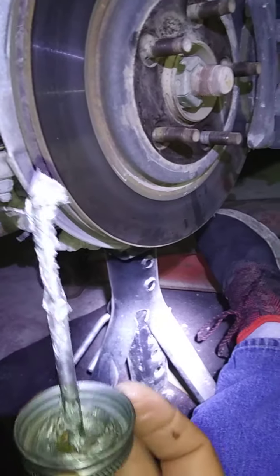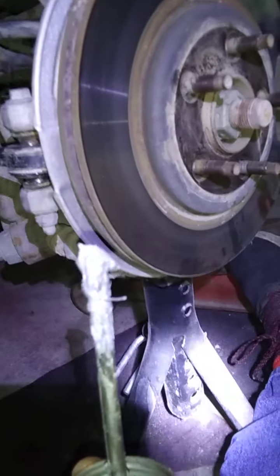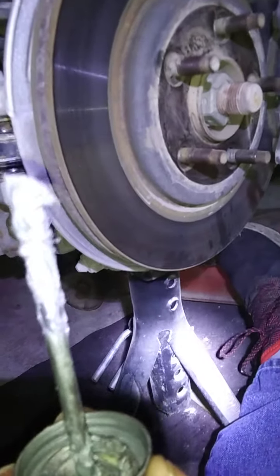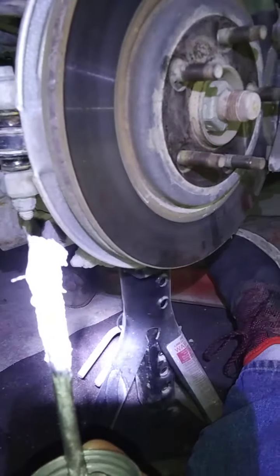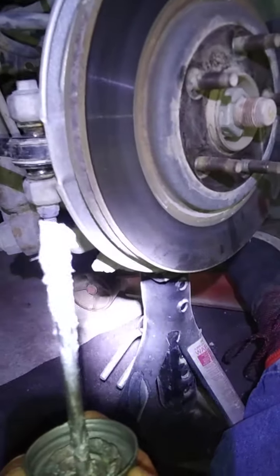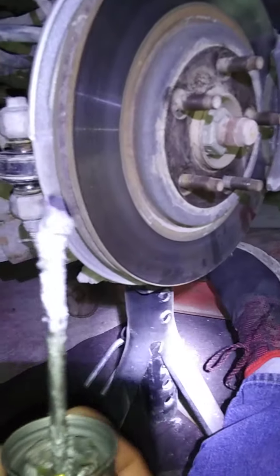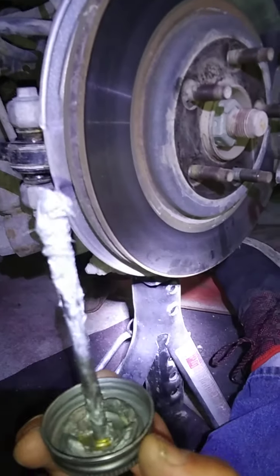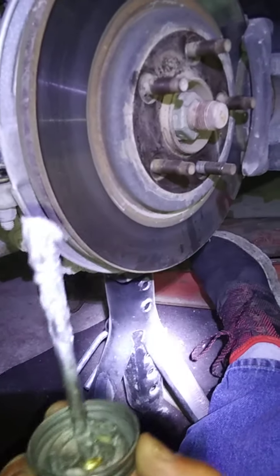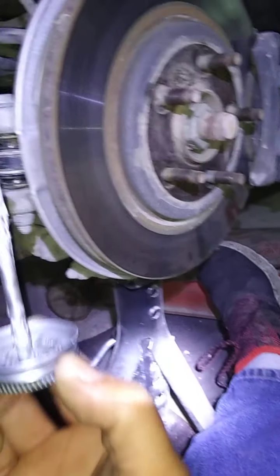basically ceramic balls, is inside that lubricant that won't wash away. And if it does move, it doesn't grind, it polishes. I said to polish headlights, you use 1,500 to 2,000 grit, to polish a lens is perfect on Lexan. This is 5,000 grit. Believe you me, Beretta uses this super fine to break in their brand new firearms. They don't use oil. They're not perfect, so to make the slides work perfect, they put 5,000 grit in it, which this is.